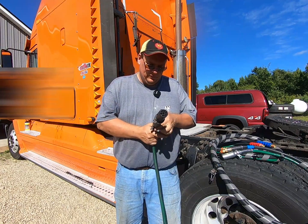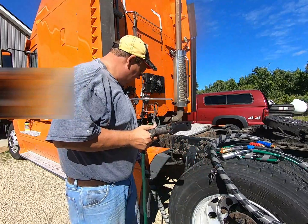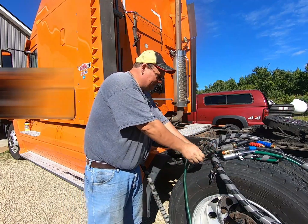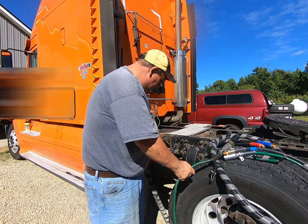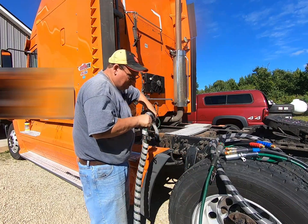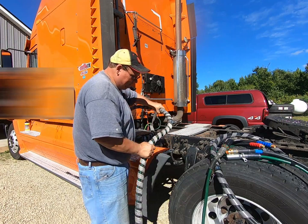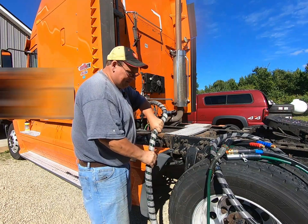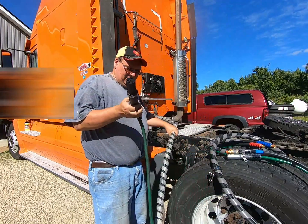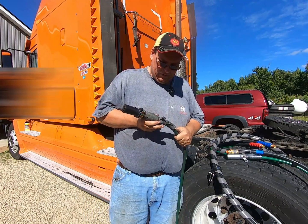Couldn't find the problem. So I'm like, well, wonder if my cord is bad. So I plugged this in here, and it was darker out so I could see it flashing better then. But I just set it down, and I grabbed my wiring and just started doing this while I'm watching the light there blink. And I found that when I bend it in a certain spot, it stops blinking. So I have a bad cable here, and I'm going to replace that.